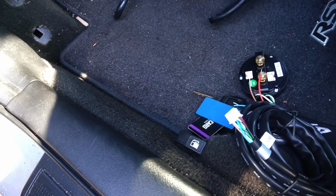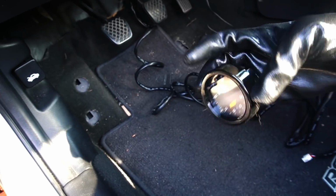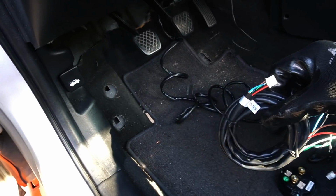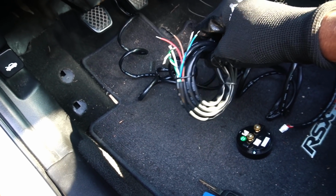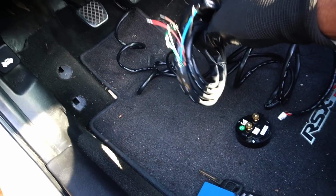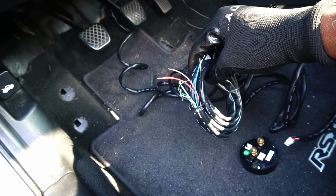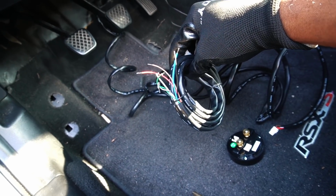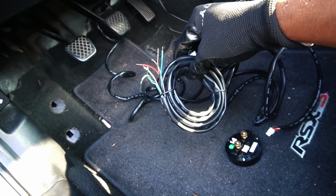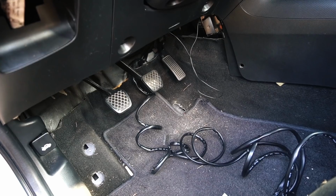Okay, so now that we have our main source that we need to have inside the cabin, we have it. This is in here. Here's our face and our gauge, and this is what plugs into the gauge. This is what we wire into power and ground. I'm gonna power this to the fuse box, probably using the radio slash cigarette lighter fuse, since that's 12 volt crank on, power on, ignition on. And I'm just gonna ground that to probably where I have my push start grounded. So yeah, man, pretty simple.